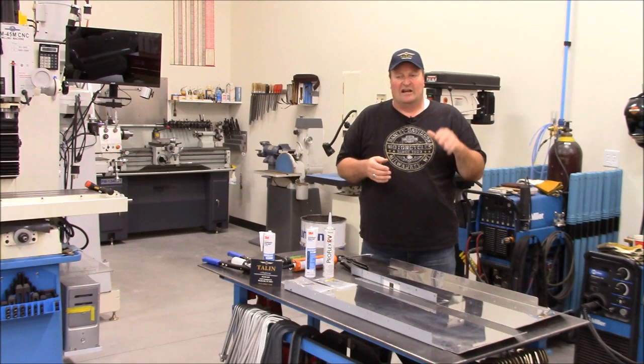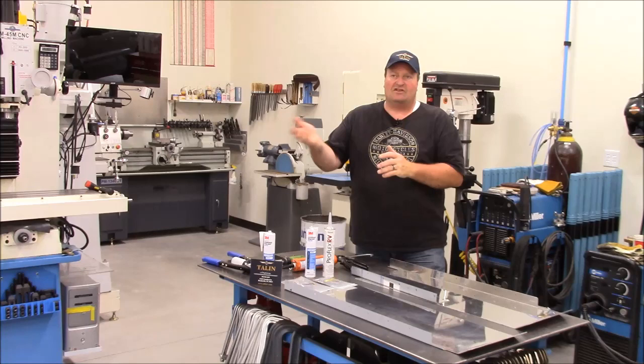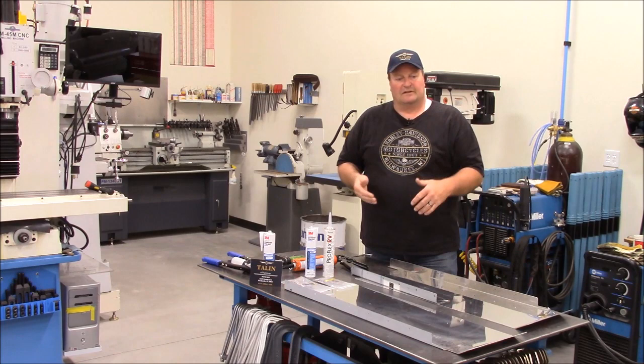Most of the rollers are going to be chassis mounted, meaning they're mounted to the actual coach along the subframe. But a lot of the galleys, and actually some of the other slides, have an inverted roller, if you will, that rolls across the tile floor. So it'll be up in like if you have a peninsula style kitchen where the cabinet kind of kicks inward a little bit.